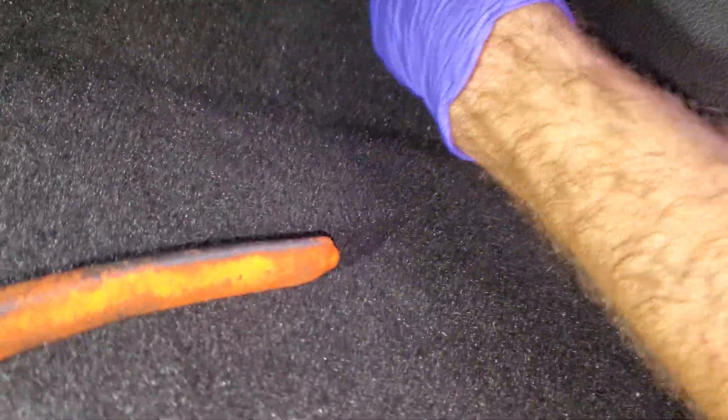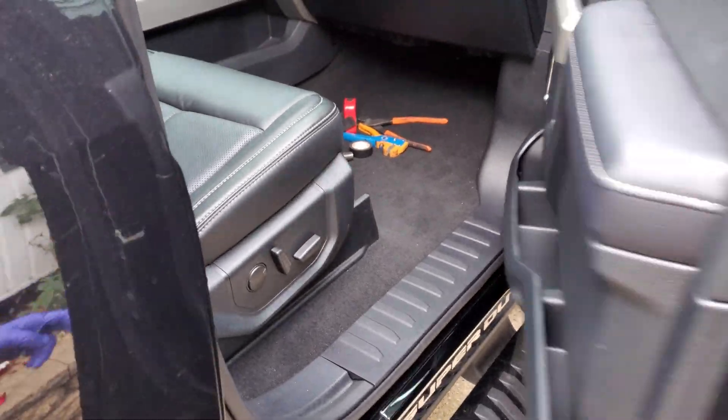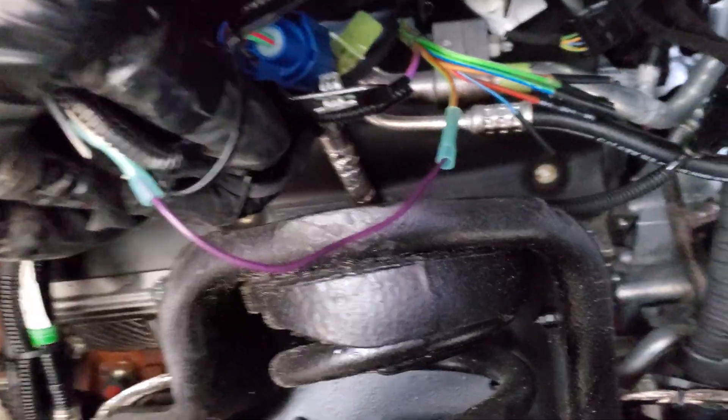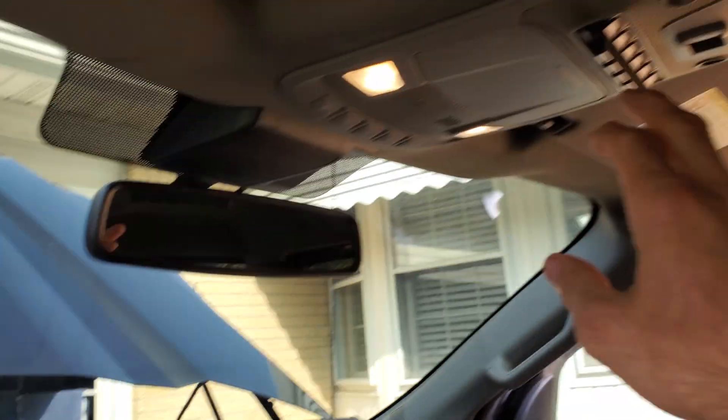After you're done, go ahead and line your slits up and close your little door. Now let's check — the parking brake is going to have to be on — let's check out our stationary elevated idle control. We need to hook up our last wire, loosely mock this up — keys in the truck, hood up, parking brake on. Going to go ahead and start it — watch the RPM — switch one.